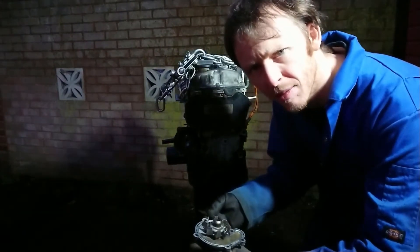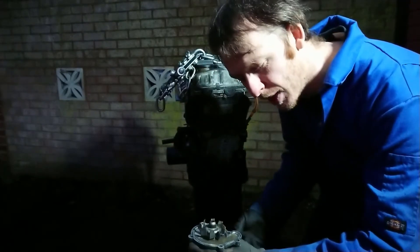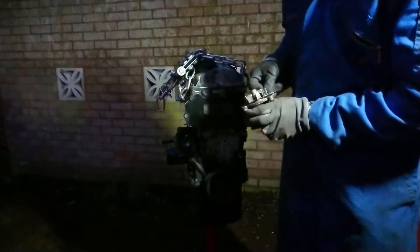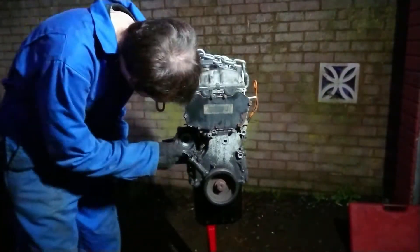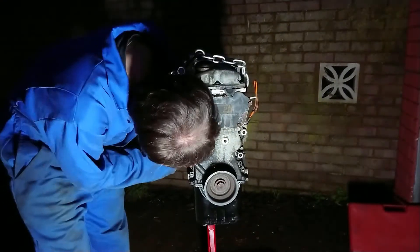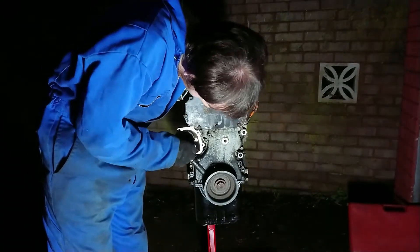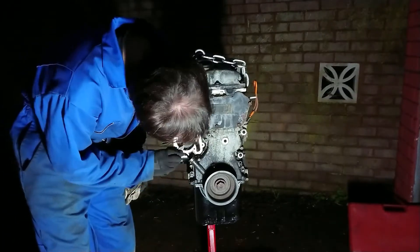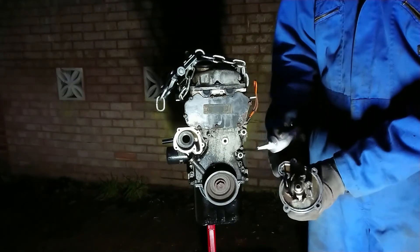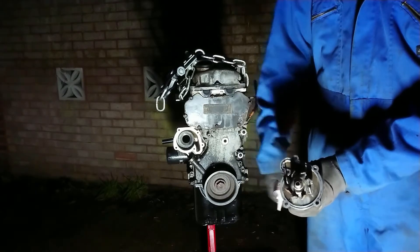It's really important to get your surfaces clean before putting new sealant on, so I'm going to use a stainless knife blade to scrape off the old sealant. You need to put enough sealant on to get the water pump to seal against the block, but don't put an excessive amount on so that it slurges out into the inside and clogs your water pump.